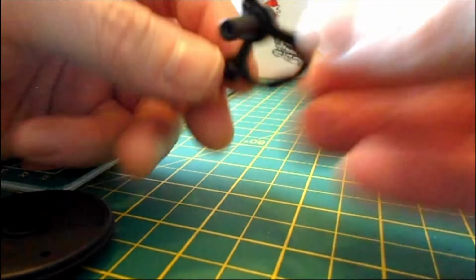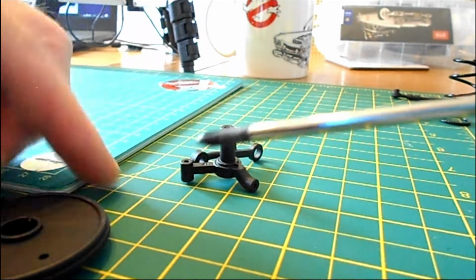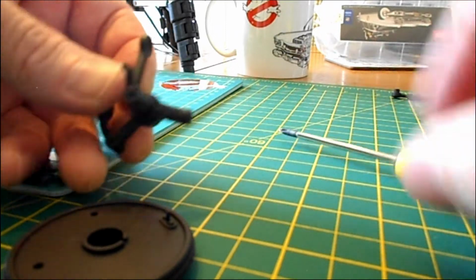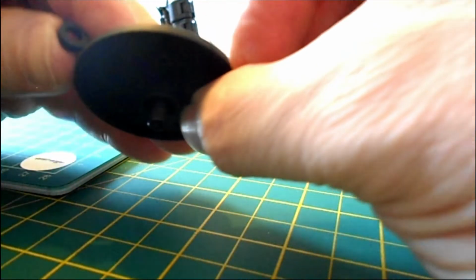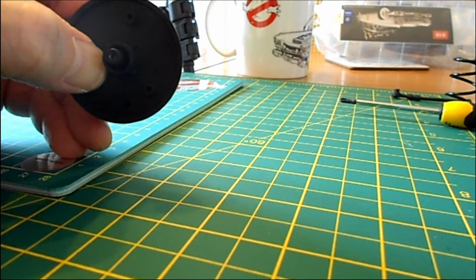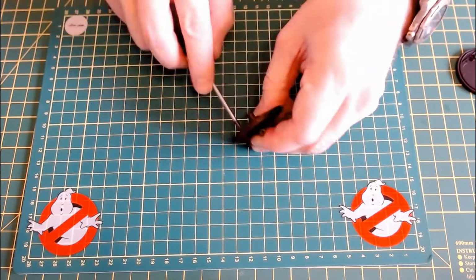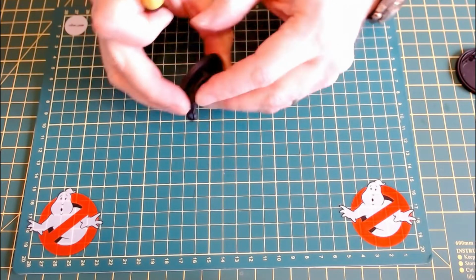Now there is a tiny, difficult to see I guess, keyway. There's a keyway on the backing plate, and there's obviously a key on the steering knuckle. So push that through, make sure it sits flush. It doesn't actually sit flush if you haven't got that in. So put that in nice and flush. And then secure that with two EM screws. Tight. Yeah, they're nice and tight.